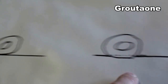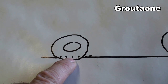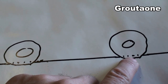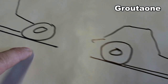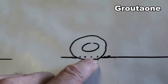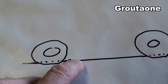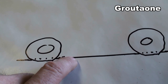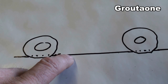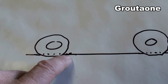There's one more factor: the tires themselves can actually pound down into soft terrain and you'd lose some ground clearance because of that also. So what starts off as what looks like enough ground clearance gets less and less when those other factors are taken into account. The driver could end up with a back injury if the frame hits the ground, because unlike a dirt bike or ATV you can't use your legs as suspension — it's all relied on the machine's suspension itself.